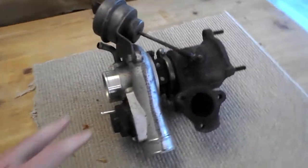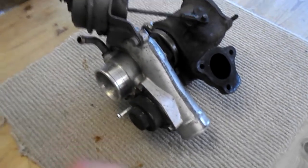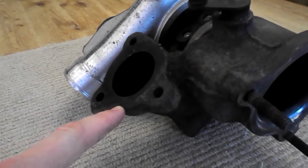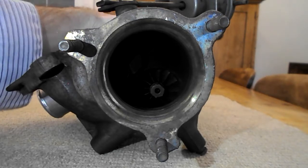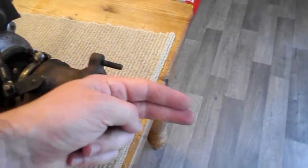At the same time, on the compressor side or the cold side, compressed air is fed into the engine air intake. As the exhaust gases enter the turbo, the housing gets narrower and narrower, and this speeds up the gases. The gases that have entered the system then force the turbine to turn, as we can see here, and then they exit out through the exhaust system.